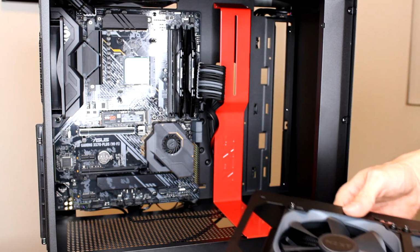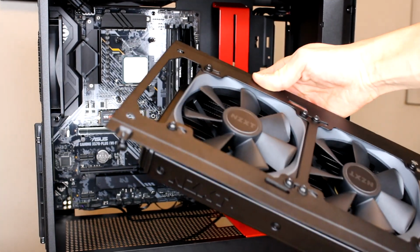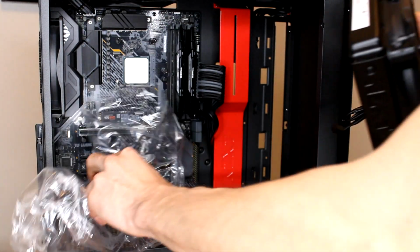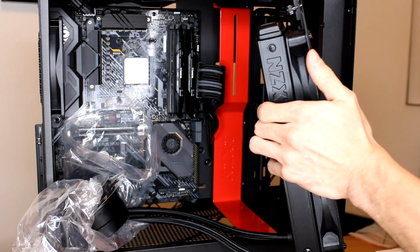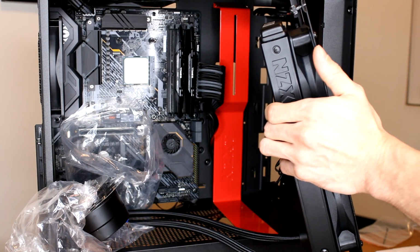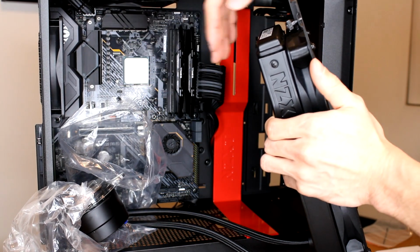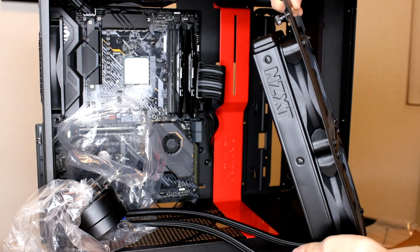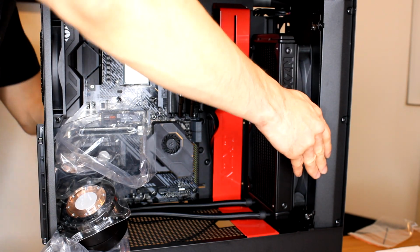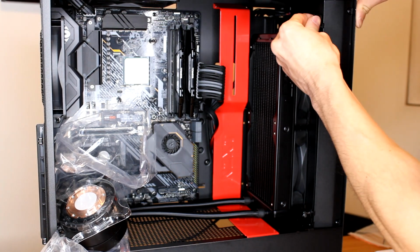Okay, now that we have our fan bracket attached to all the fans and the radiator, what we're going to do is we're going to place this back into the case like so. If you're interested in my orientation of my hoses facing down on the radiator, I'll leave you a link on Gamer Nexus's breakdown on why you should keep the hoses down and your pump on the bottom. So I'll leave a link in the description on that. Once you got it back into place, go ahead and screw these two screws back in.